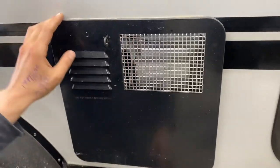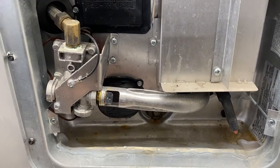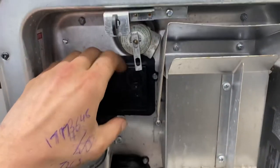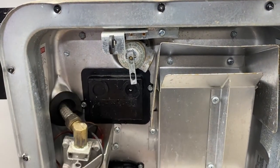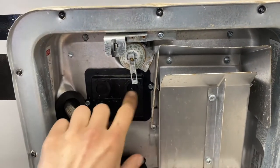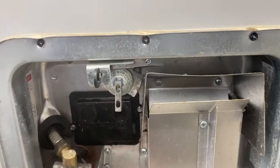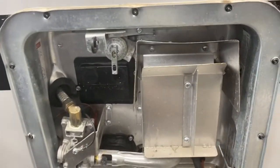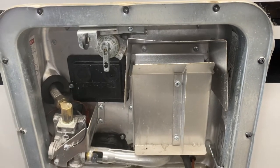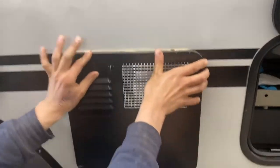Up from there is your hot water tank. Line up that keyway and you can pop it open. Down in the bottom corner there's an electrical switch that turns your hot water tank on with electricity. Up in the top we've got a reset button for your propane system — turning it on with propane uses a switch inside the unit which I'll show you later. Above that is your pressure relief valve — before you ever turn it on, hit that valve to make sure a shot of water comes out, confirming the tank is full. If no water comes out, make sure your water system is turned on and the tank is full before firing it up so we don't burn anything out. To close, line the keyway back up and lock it down.